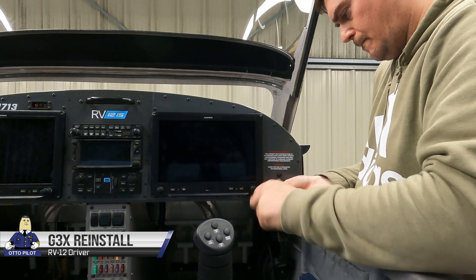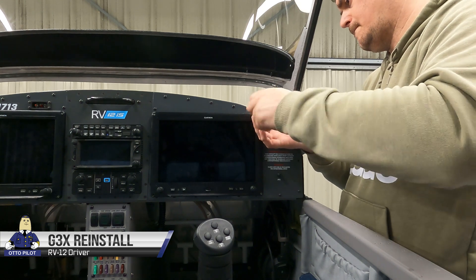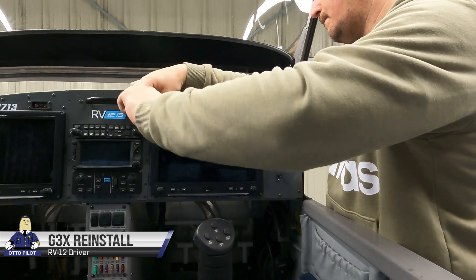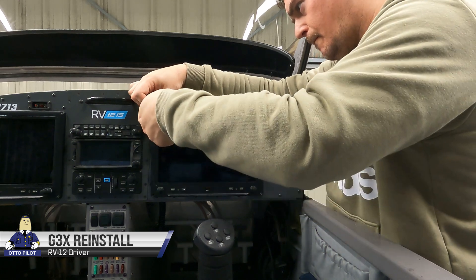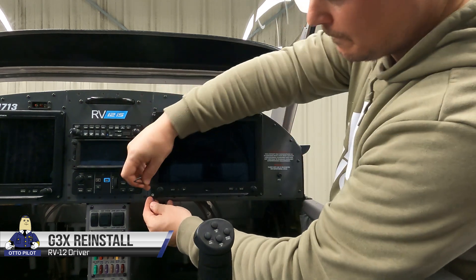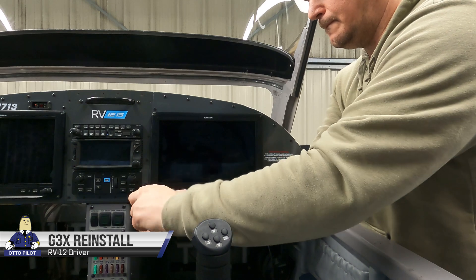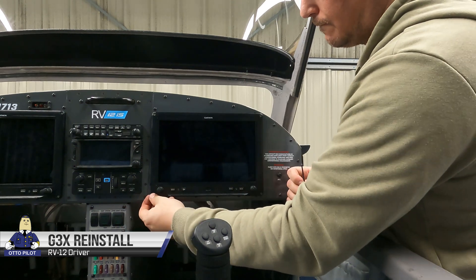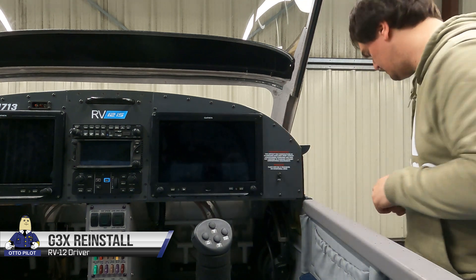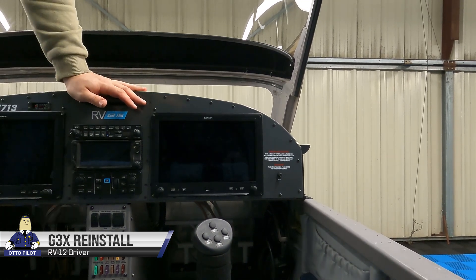I don't have any test equipment to really see if you get a benefit. If somebody wants to throw some temperature sensors behind the panel and do a before and after test, that would be good — but there are so many variables involved. All in all, these fans were $15 each plus a couple bucks for shipping, and it was fun to do a small improvement to the plane, especially something that only takes half an hour. Also, regarding these screws on the G3X — I don't know if I got a bad batch from Vans that rust, but I got zinc coated steel cap head screws instead and I'll put the link below.